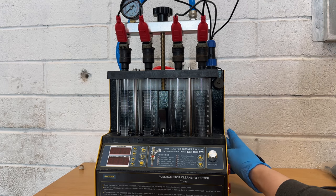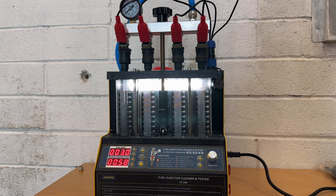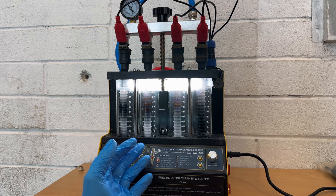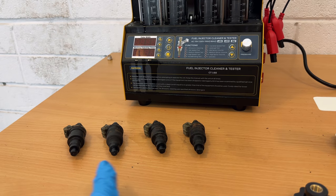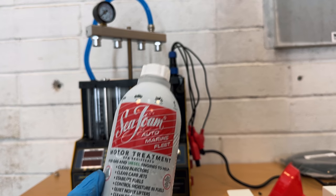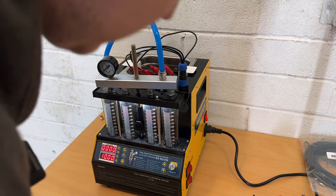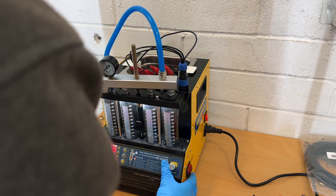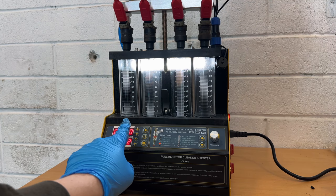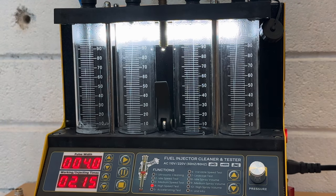Let's have a look at this power switch. Idle speed test - let's try this. These two here are filling up a little bit quicker than this one and that one. They just probably need a clean - they've been sat in the car for a long time. So I've now taken the injectors out and I'm going to try and work out how to clean them in this bath-like thing back here. I have this Seafoam motor treatment which is supposed to mix 50/50 with petrol. So I've put 50% Seafoam and 50% petrol. He's building up quite a bit compared to the others - that one is really, really going for it. You can see the difference between them. Let's get that in the bath, leave that to clean for a minute.